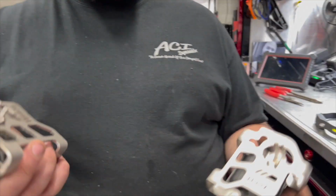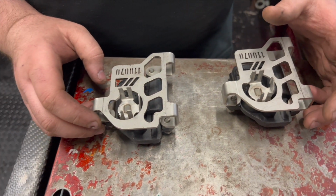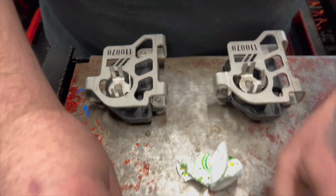Right. We discovered that on a new RS5. We didn't put the valves in, and we were getting half boost with no codes, and we were wondering what was going on. Well, once we put the AWE simulators back in and hung them in the rear, they're going to open and close on their own, and it's going to see if it's in dynamic or comfort. But without doing this, the car will go into a limp mode, so we need to make sure that we do these. So AWE supplies these brackets. They supply zip ties. You're going to put them in the corner of the car. Sweet. So we're going to do that now. Thanks, Nick.